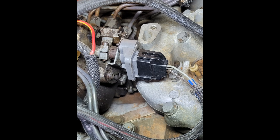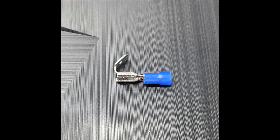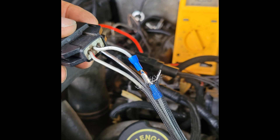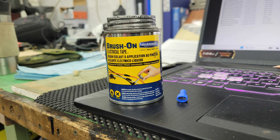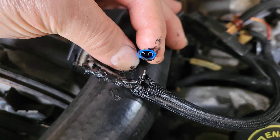When I went to try and carry out the voltage check, I found that the wires going into the TPS are very well sealed and I did not want to start sticking pins into the wire insulation. The test procedure and the adjustment process that I had researched clearly said that this would take time and to be patient. My solution was to splice the center pin wire and insert a permanent wire lug that has an extra male connection. It is this connection that will be used for the testing. The test connection point will be covered by a blanking plug that I just made out of another insulated lug.